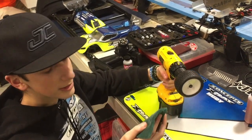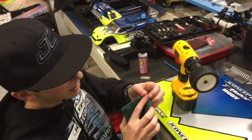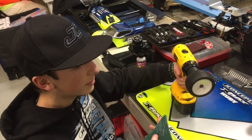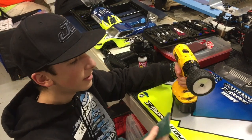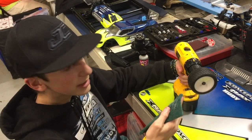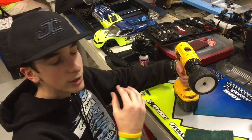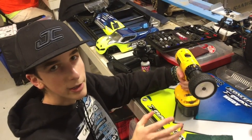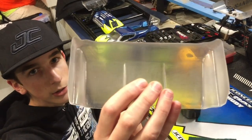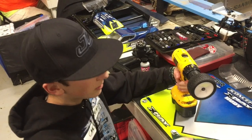First thing you're going to do is take the Scotch-brite, just put it in your hand. I put my finger right on the corner, and then you just get the drill going at a comfortable speed — maybe a little bit faster — just so the tire's not ballooning. You're going to scrub the tire, scrub the sidewalls on both front and back, and get it so the glossy shine goes away. It'll be just a nice scuff, basically like taking a wing from new to scuffed.